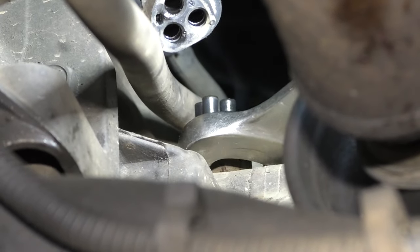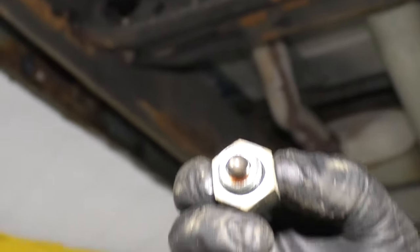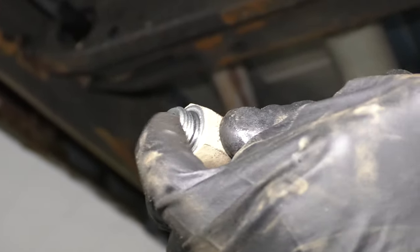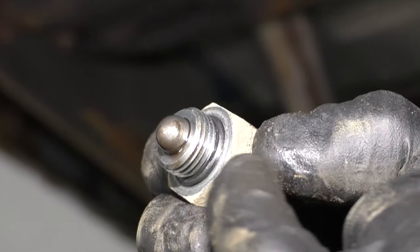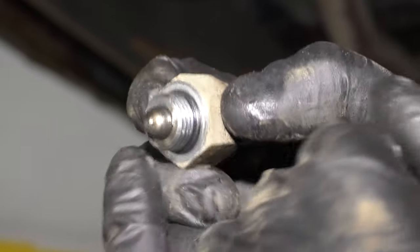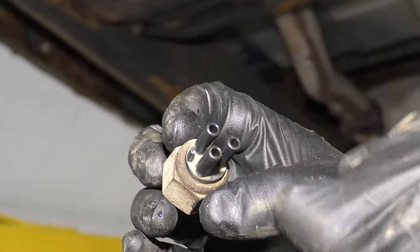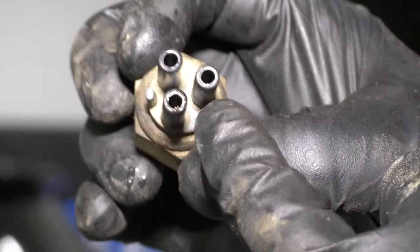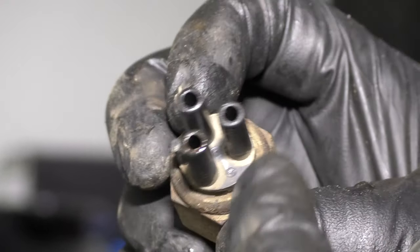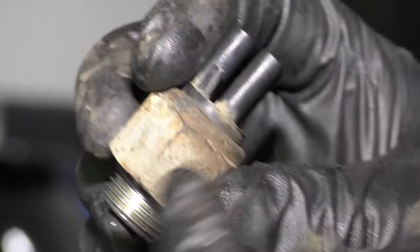In that case, when you shift back into two-wheel drive, the front differential is still engaged — causing excessive fuel consumption and wearing of front end components. To take this out is pretty easy, just use a seven-eighths wrench and pull the vacuum lines off. If you see that little ball flush with the bottom of the sensor, then that ball is stuck. It should normally protrude out, and the transfer case just pushes that in. But the worst symptom is actually this leaking transfer case fluid — if the seals inside there go bad, it can cause a lot more issues.